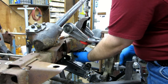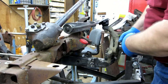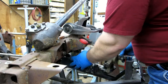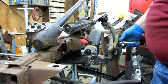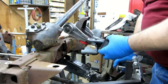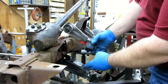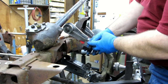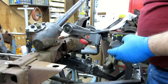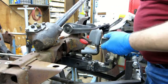Okay. When coming up with the bump stop in place, I don't know if you can really tell here, we're 1 inch above that rod there. Take it out, it comes up almost another inch, and I measured this as well, and it is almost exactly 1 inch difference. So that means that this is a cutoff bump stop, which is more or less approximating full squish. I have another inch of travel at the spindle past that before the ball joint binds, because that's what's happening right here. Ball joint's binding. I'm not hitting the frame or anything. It is the upper ball joint binding.